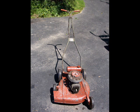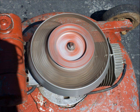After I replaced the condenser and the coil pack, cleaned the point, adjusted the gap of the point, and put everything back together, I tried to start the mower. It maybe didn't run for 30 to 40 years. It took me a couple of pulls to get it started, and it runs good.